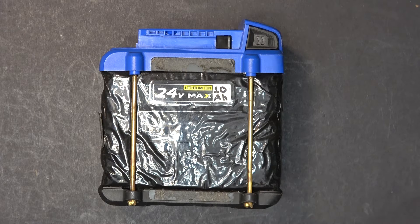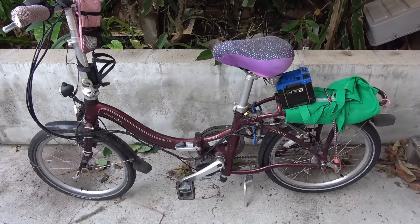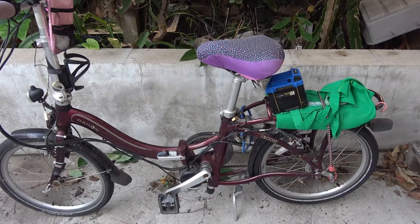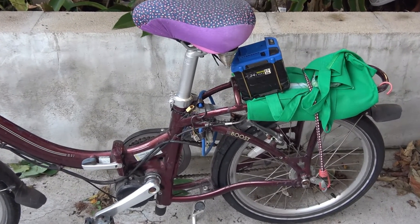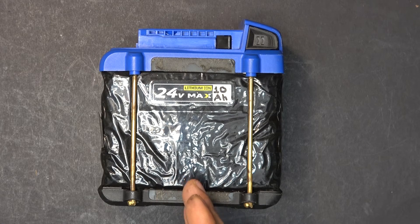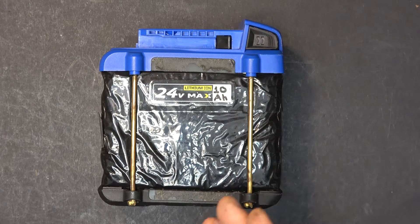The third advantage is its versatility and flexibility. Because they are 24 volt batteries, I can use them for other EVs with different voltage requirements — like a 24 volt electric bike, scooter, or go-kart. I can also use them for a 72 volt electric scooter by putting three of these in series, and voila — I have a 72 volt battery pack.